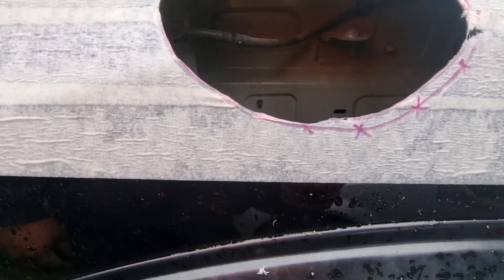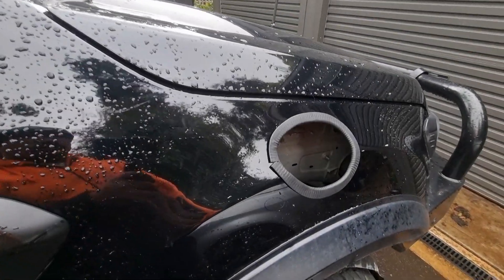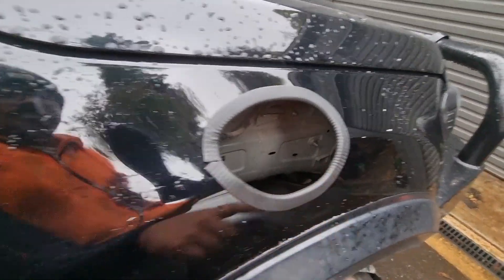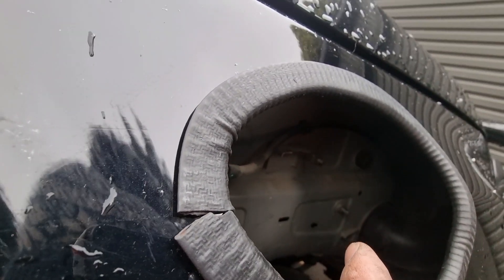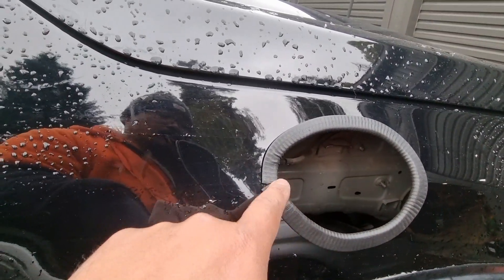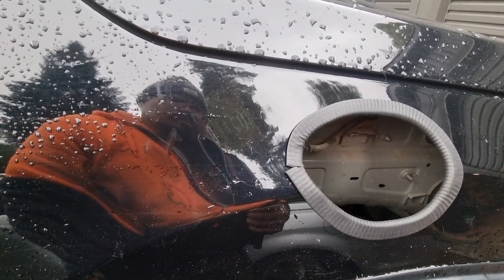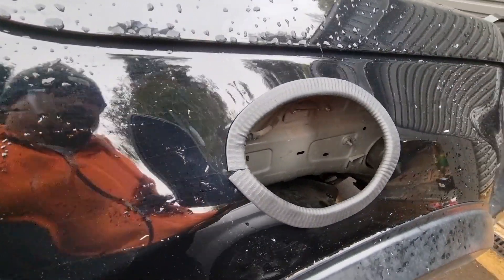Took about three minutes — easy. We've nibbled out the hole and pinch-welded it temporarily to test fit. I've trimmed that bracket there and that bracket down there because it was touching. I'm going to test fit again and then Sikaflex this on when I'm ready — that'll seal the paint. Some people use paint but that'll scratch off straight away with a little brush. Sikaflex however will keep the bare steel protected.